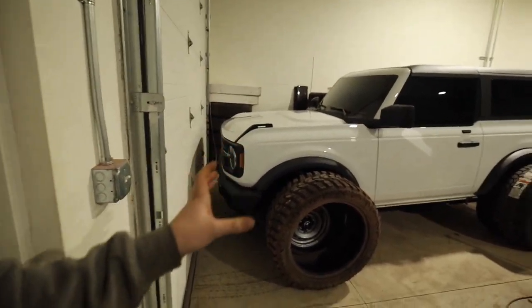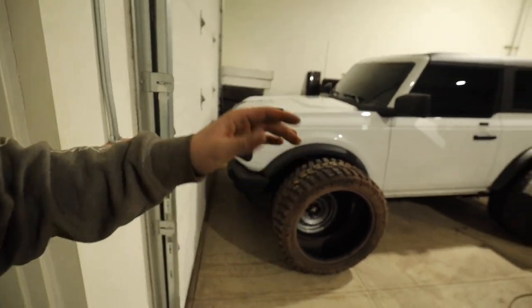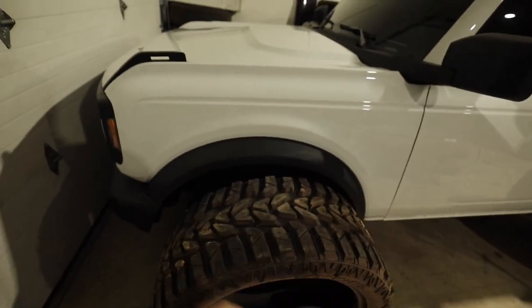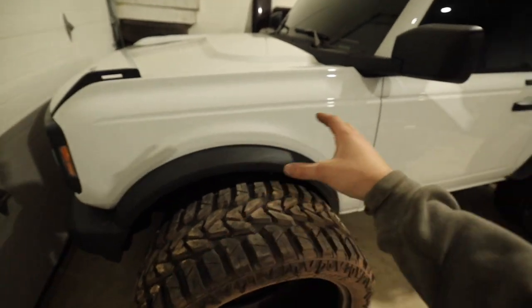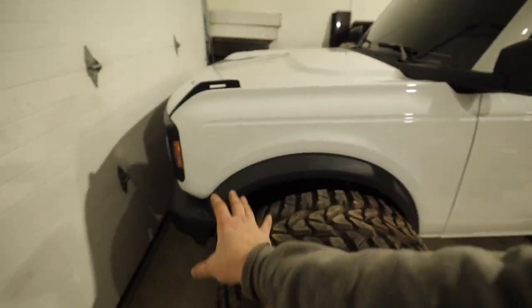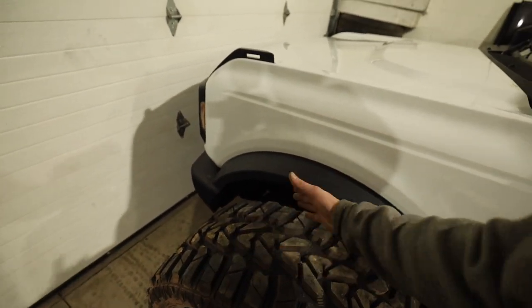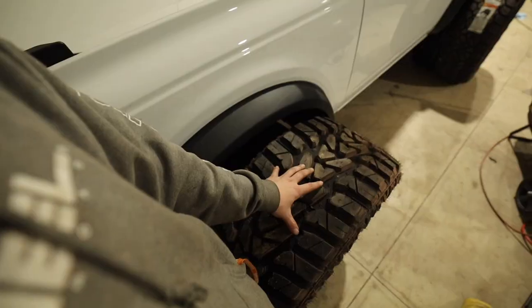That's why I was trying to see what tires will fit even with a little offset and no offset. That lift we have coming can in fact clear 42-inch tires - yeah, that's pretty ridiculous if you remove those crash bars. I also think it'll fit 42s at the lift height with crash bars removed, probably at zero or positive 12 offset. I know for a fact it'll clear 40s on a zero offset. I personally like a little bit wider tire, so I'm trying to figure out if 38 or 40 will be my max at that lift height.